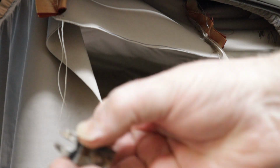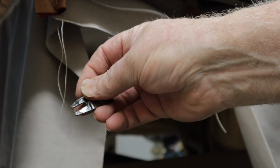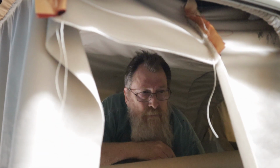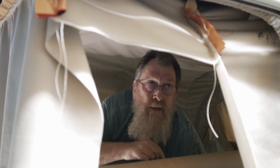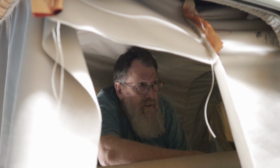I'll show you. It's got these little clips here that slip over the rod. They slip over the rod and drop on a screw, and you tighten them up. The other end's just got a little hook on it that hooks into the headliner here. Now, because this one going to the center here doesn't have any little catches, it hooks under the body of the car. It's got a little prong sticking out that the rod actually catches on. You poke holes through the listing and it holds it. So you got to hook that one up first and pull to the back, tighten that up, and then you got to pull the front.